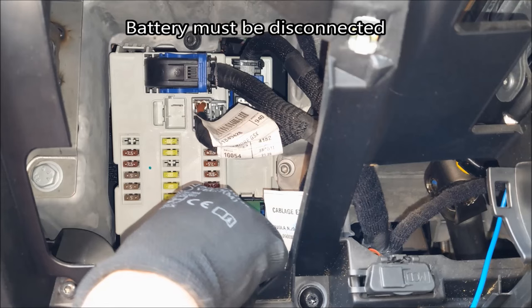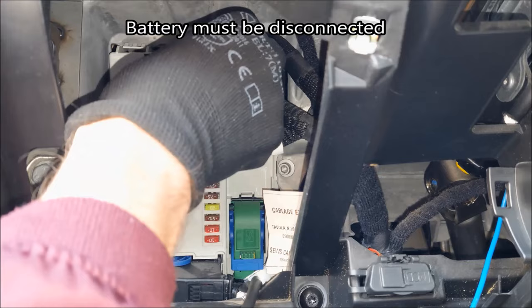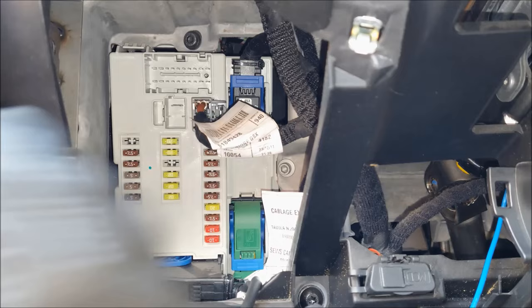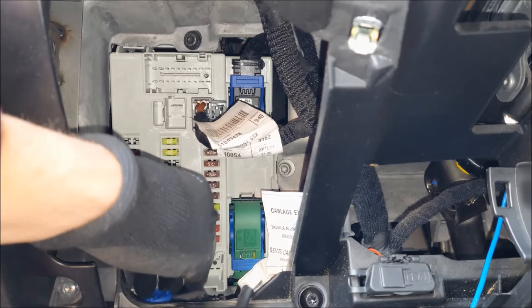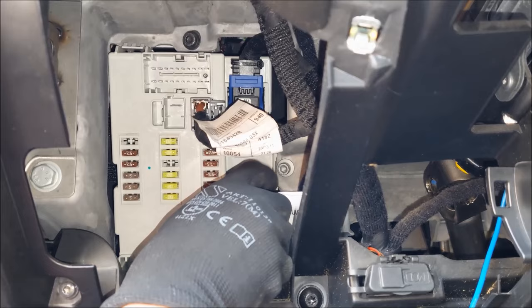Now here comes the interesting part. At the beginning of the video I said I'm not going to use any CAN adapter or decoder, which poses three issues: we didn't have the ignition-on wire, which I just solved, and I also need to hook up the steering wheel controls. To do that I'm going to remove the body control module and connect some wires. I'll do a detailed video on BCM removal but it's actually quite simple — you press the clips in, put the levers up, undo all of the connectors and three screws.